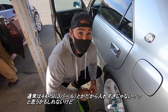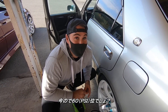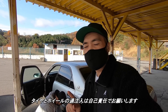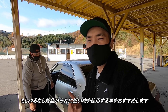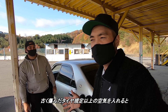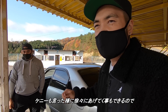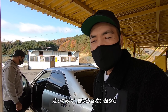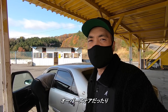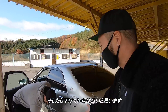Most people are probably thinking that's insane — these tires are rated at 44 psi, which is about 3 bar, and he's running close to 4 bar, which is close to 60 psi. Over-inflating your wheels and tires is at your own risk. I really recommend doing it only on new tires, because if you have old dry-rotted tires and put too much air in them, there's a possibility they'll blow up. You can gradually go up — go out on track, and if you're struggling to initiate, go up in air pressure. If the rear is coming around too much and spinning way too much, that's when you lower the air pressure. This is free horsepower right there.